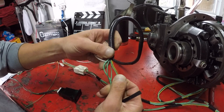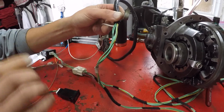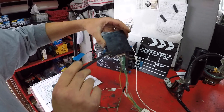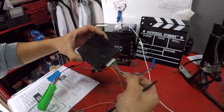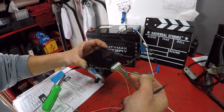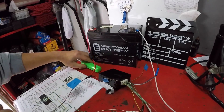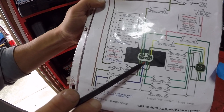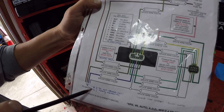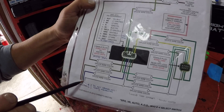The remaining five wires go directly through this wiring harness and the five wires will then plug into the ECU. There are two wires that come out of the ECU that you need to ground: the blue one and the white with black stripe. These I've put together as a ground, following this wiring diagram for the ECU. You can see number eight is the blue one being grounded out, and number seven is the white with black stripe, also being grounded out.